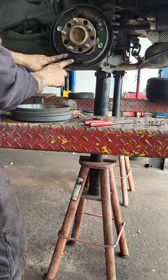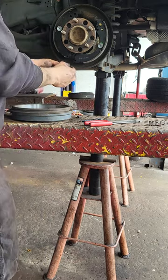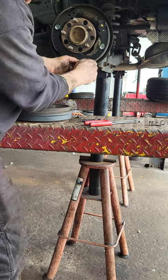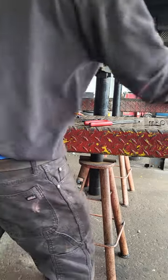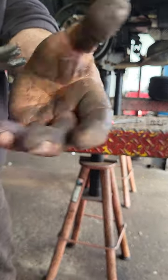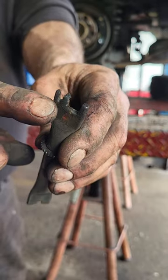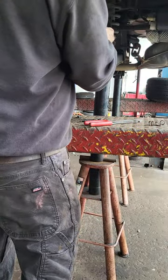I always want to make sure your party hats are in the lock tabs. I like to pull the shoes over the landings at the bottom. I'll hold the spring in and then I'll just stretch them over. So now that's in place. And then the adjuster — back it all the way down. Make sure there's grease there; it's good, doesn't need anything special. Make sure you put these pieces in the right spot — the thicker part goes to the very inside back.